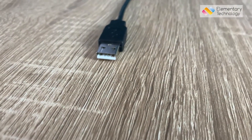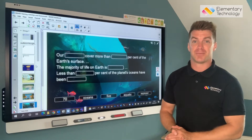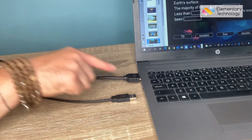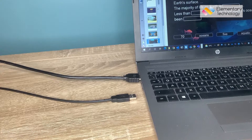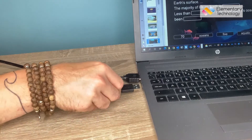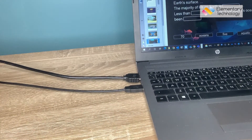There's some problem with the USB, it's probably just a loose cable. So let me show you how you can sort that out. The HDMI cable is plugged in and that's why I'm getting the image and sound on the screen. I'm not getting any touch because the USB cable carries the touch and the USB cable I've accidentally pulled out at some point. So I'll just pop that back in now.